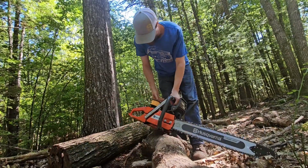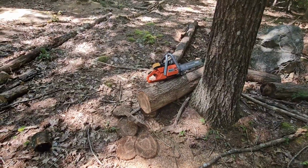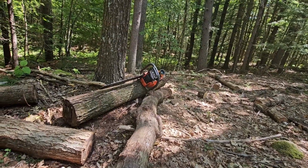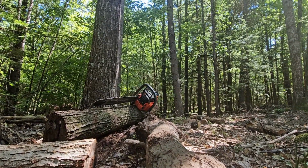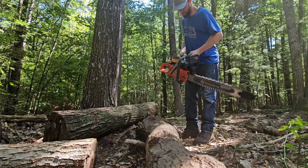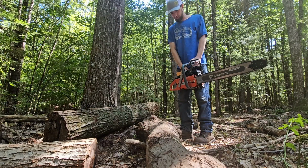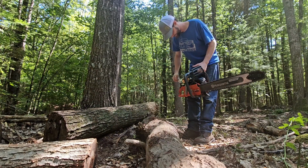And now it's doing the thing where it gets stuck on high idle. I'm done with this carburetor. One last thing before we just swap this whole carburetor out. Watch this. I've tinkered with it a little bit more. I've gotten it so it cuts good, doesn't 4-stroke, but then it dies the second you get off the throttle. Never mind. Now it doesn't want to start. I just had it perfect. Apparently not.